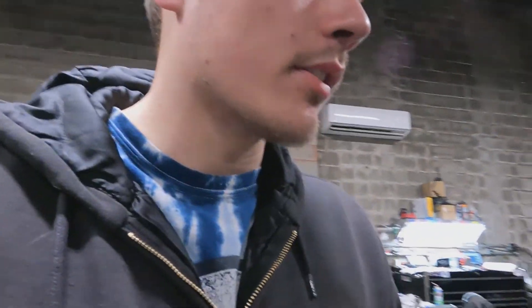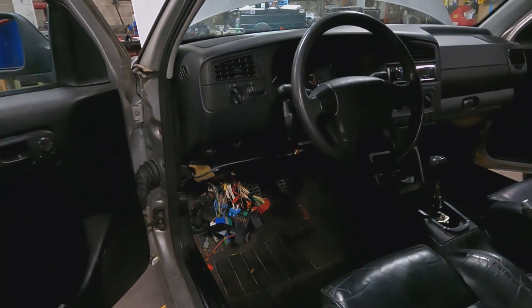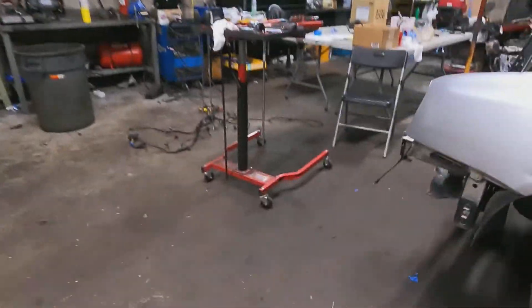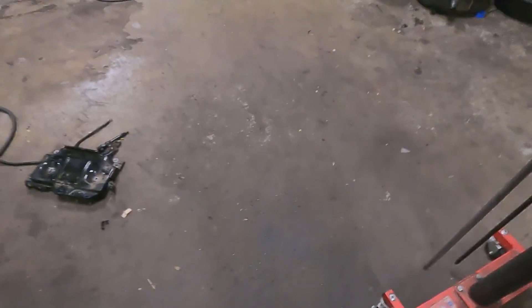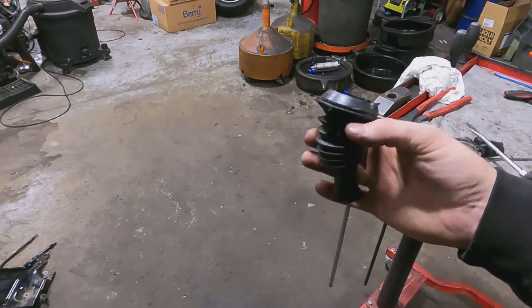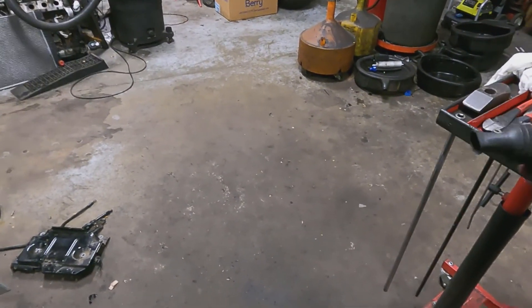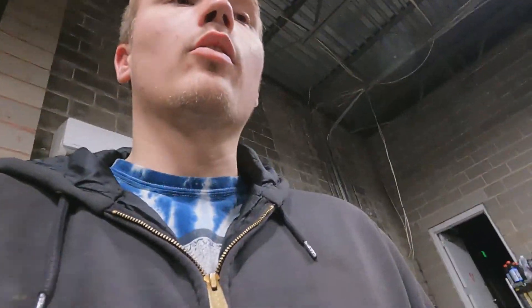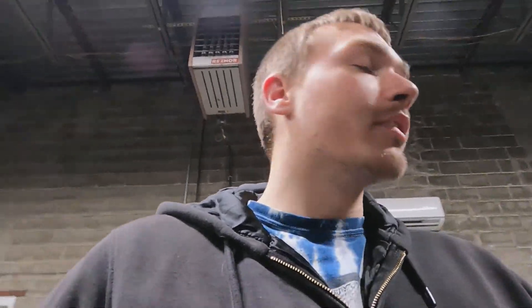You just got to do things yourself sometimes. Getting the chassis harness back in and plugging everything in, trying to locate it as nicely as possible. I'm going to use this other hole right here — I have a few of these Mark 3 grommets that fit the firewall perfectly and have the holes for it. I'll be able to run all the Mark 4 ECU wiring through this and just hardwire everything in. It's not technically hardwired because it can be removed — you just move that little latch on the fuse box and you can take each connector out. So it'll be a branch running directly to the fuse box but it will be removable.